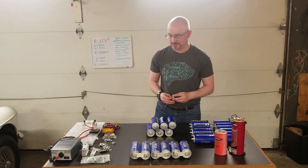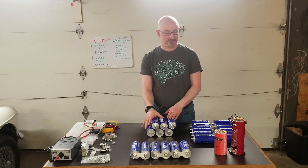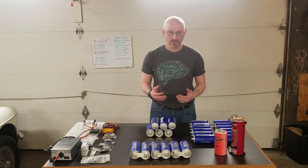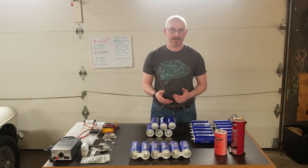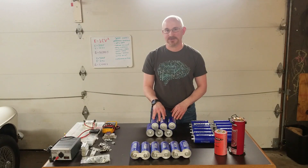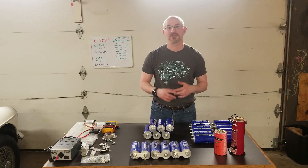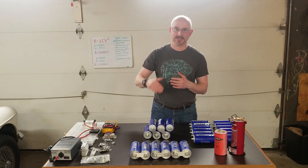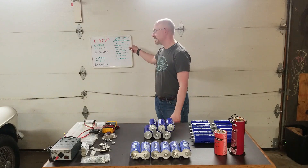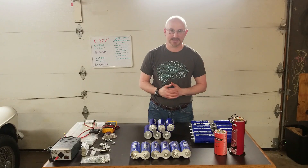Now we're going to talk about safe implementation — how to safely install, charge, discharge, and implement these in your car. Manufacturers have been using ultracapacitors in automotive vehicles for many years; there are millions of cars on the market today with ultracapacitor banks in parallel with standard batteries. Capacitors have the advantage of reacting very quickly, and they have a very long life. This capacitor has a duty cycle of one million cycles, over which you'll see a 20% reduction in overall capacitance.